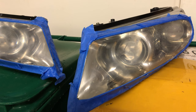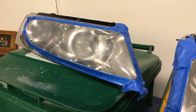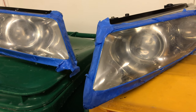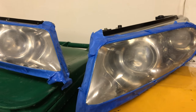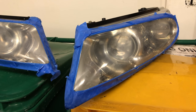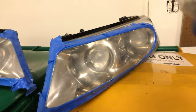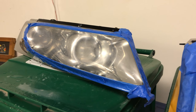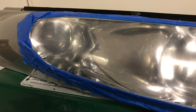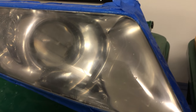So I'm going to clean these up using isopropyl alcohol and distilled water mix to get all the remnants and debris picked up, then let things dry out, fix the masking, and then spray with the 2K clear coat. Because the headlight units are detached from the car, I'm going to use a garbage bag and cut out a little piece to mask around each one. So I'm just going to mask off the whole thing with a garbage bag on both of these and then get spraying. I'm not thrilled — you can tell me what you think, am I being too picky? There's just a little haze.